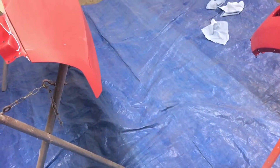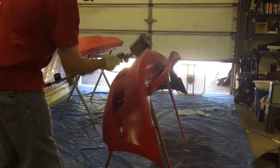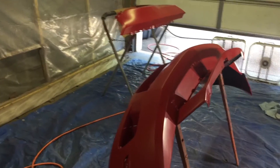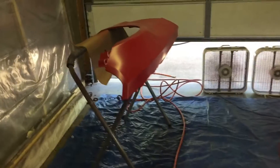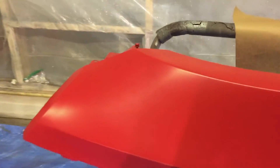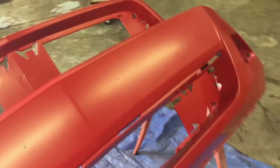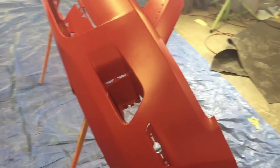So we'll get some red paint from the gun, get all that stuff sprayed, and then try for the clear again. We've got the easy part done — the color. Didn't have any issues with that, which you hardly ever do with color. Got all the bare spots covered, blended it over to that corner. Everything's covered on the bumper. Now I'm going to let it wait 30 or 40 minutes to make sure your flash is really good, and then we'll start the scary clear coat part.